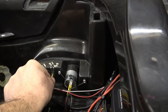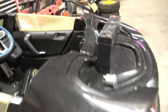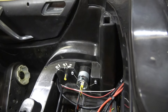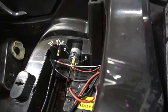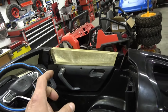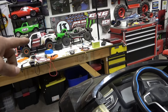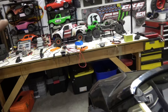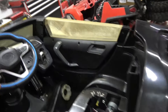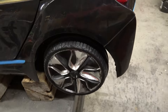We'll turn that down to 18 volts. See how it rolls to a stop — hit the gas and then the brake, you can hear the relay click. That shorts out the motors, but we put a resistor in there to resist and we'll go over that on the bench. Another cool thing: when you put it in reverse it cuts the voltage by two thirds. See, it's got reverse.